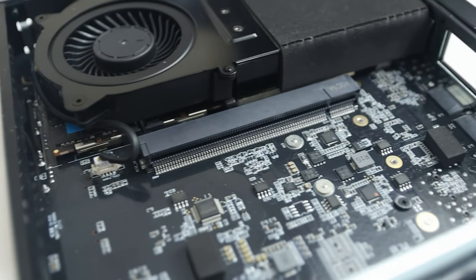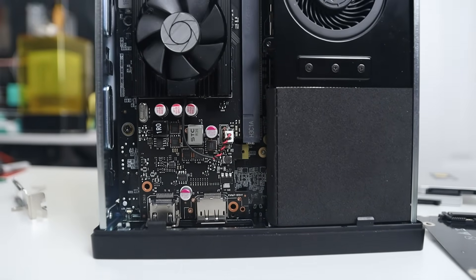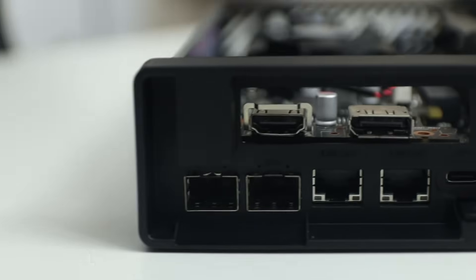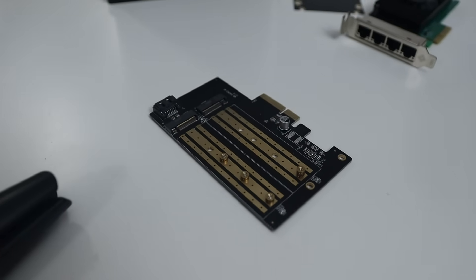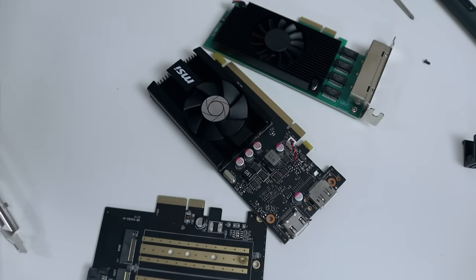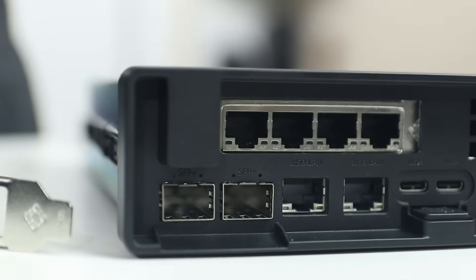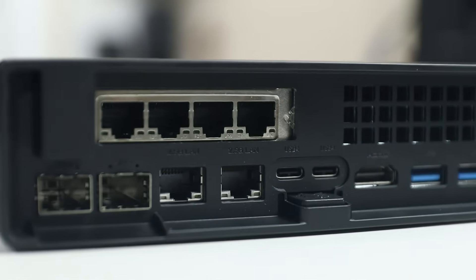The first thing you see is a large 16-slot PCIe connector — but don't get confused, it's actually an 8x slot, not 16x. It is PCIe 5, with a direct connection to the CPU, so it's not going through any chipset, which is both a good and bad thing. You get PCIe 5 speeds, but you're limited in what hardware you can install. For example, an NVMe card with multiple drives won't work because there's no controller to handle switching between NVMe slots. However, a 2.5-gigabit 4-port network card works perfectly fine, and a GT 1030 graphics card also works fine. Your mileage may vary depending on the hardware you use.